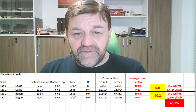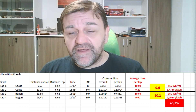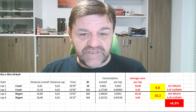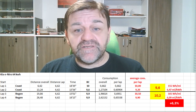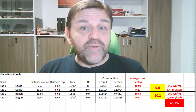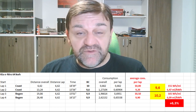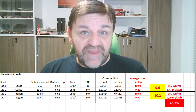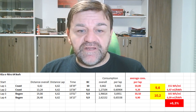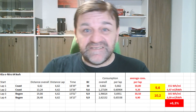Now let's have a look at the details. I've entered the consumption after every lap in this table. The consumption per lap is 10.0 and 9.2 when I tried to coast as much as possible, and 10.5 and 9.9 when I tried to recuperate as much as possible. That's an average of 9.6 versus 10.2 — or 6.3% higher consumption when trying to regen as much as possible. Looking at trip time per lap, with no regen the first lap was 18 minutes 39 seconds — heavily affected by traffic — while the other laps were much faster. I can tell you that I've done more of these tests with other EVs and differences were up to over 20% in favor of less regen.